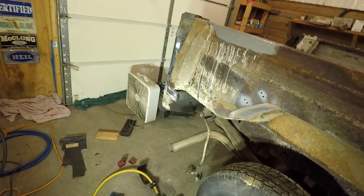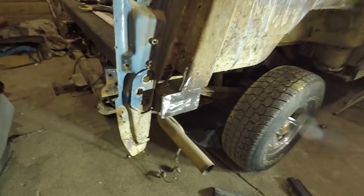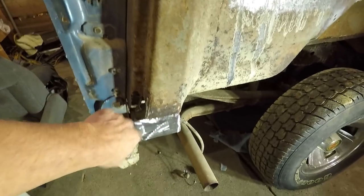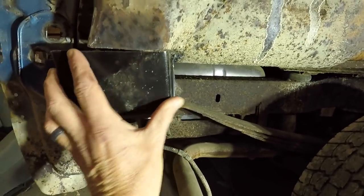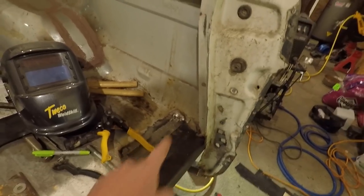So I got this sill tube — the rear tube back here that I put on — capped off. Got that welded on there looking pretty good. I need to go over there and do the other side, and then I think I need to hold off on tying this all together quite yet. It's going to end up being something like that, but I need to hold off until I get that patched, and also need a little bit over here — get all that done.